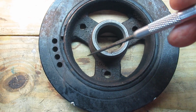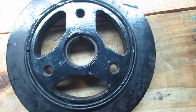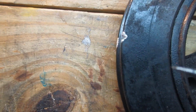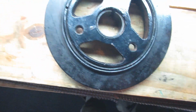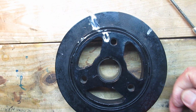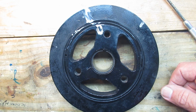So of course when this spins and gets off track like this one did, there is the timing mark where it's at. Here is the notch right here. That's where the timing is supposed to be, but the timing actually is clear over here. It has changed that much because, with all that force of driving everything, this is slipping. And of course it went out of balance and made it impossible to time. I'm pretty good at timing by ear, but getting it right on at 6 to 8 degrees, when you've got automatic advance working too, is kind of hard to do.